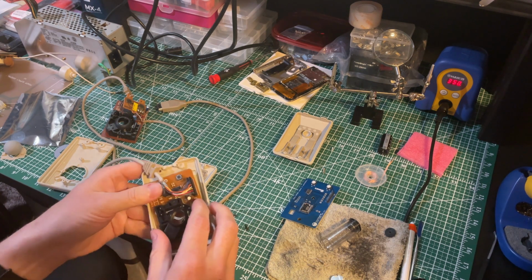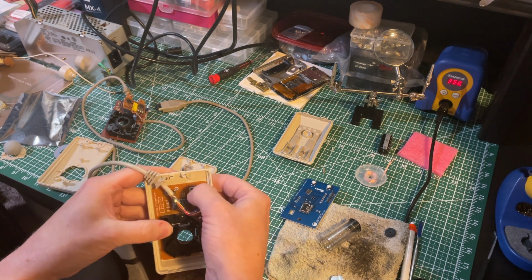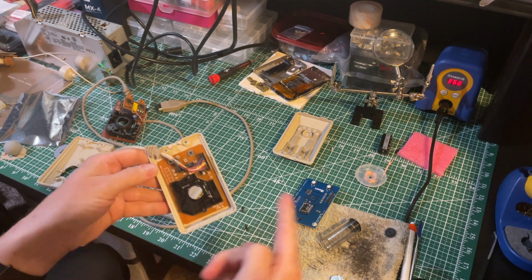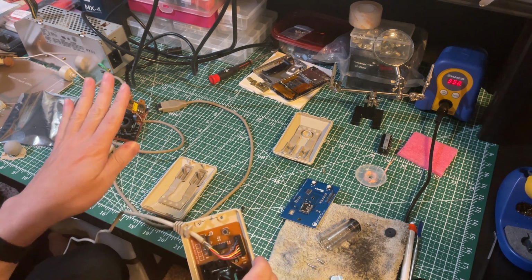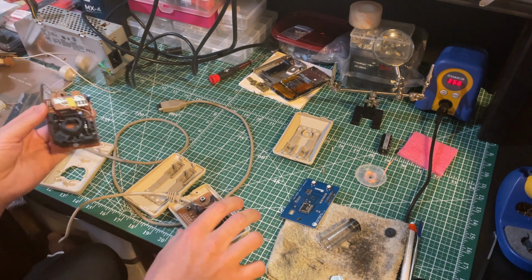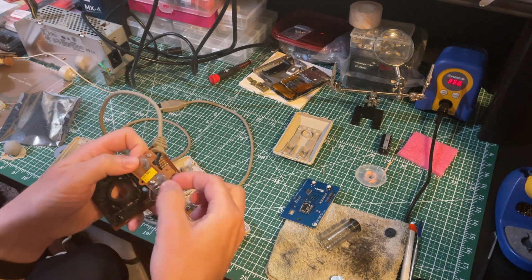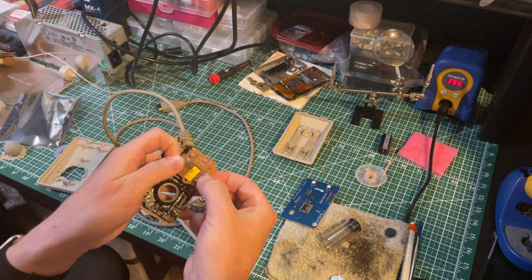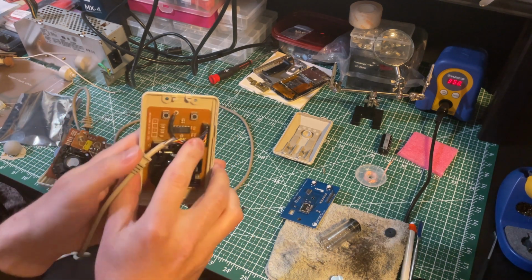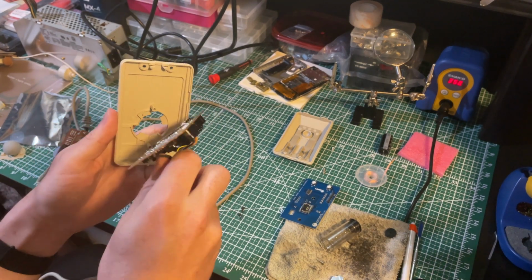If I wanted to proceed with the laser upgrade, I would have to do it with this mouse and not reuse the board, although everything in here, including the micro switches, are fully functioning. I might give it a try anyway, just to see how the laser upgrade works, and I will keep this in storage and probably just fix those micro switches at some point, although given the nature of these, I'm not sure there's a replacement for them. Whereas these switches here can easily be removed from the board and replaced with newer ones.